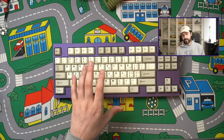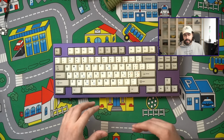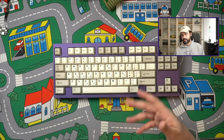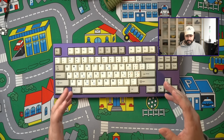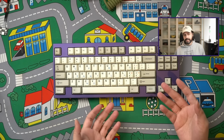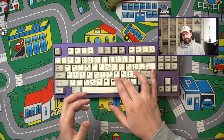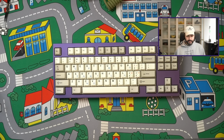Personally, I build this with Gateron X. I oil lubed Gateron X, so they're not going to sound as deep as a grease lubed Gateron X, so like a 205 grade zero or 203 grade zero. I lubed this with 107. I prefer the feel that way. Everything when it comes to keyboards is a trade-off. I trade it off having a little bit higher pitched switch sound, for a little bit comfier of an experience.